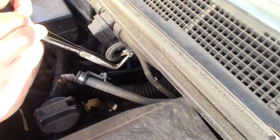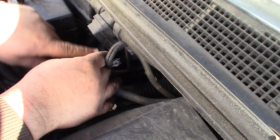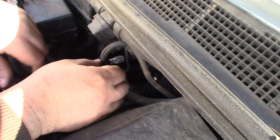And the guy's already told me that he has taken this apart and messed with the gears in here, and you can do that. There's a cross gear that goes this way, and the motor's on the bottom with the worm gear that turns the cross gear, that turns this, that turns another piece up here, back and forth. And you can just rip that out, switch it over to heat for the winter, and switch it back when you're in the summer when you're running AC. That's perfectly acceptable. I think you can buy these on Amazon for 50 or 60 bucks.